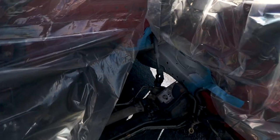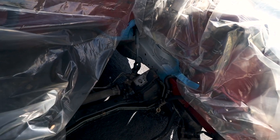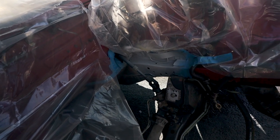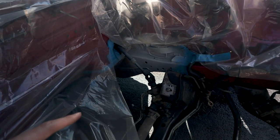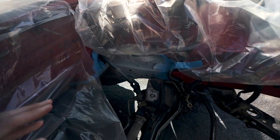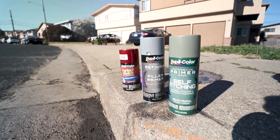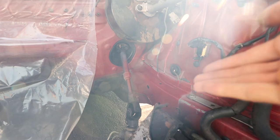Quick random update - I am painting the engine bay, a quarter of it, just so there's no rust. Definitely not the cleanest paint job. All that was bare metal due to me having a fat exhaust for a little while. All I did was scotch brite it, then etching primer, then regular primer. I'm gonna be on to the base coat so it matches. The color kind of matches - this is just a little faded. I'm gonna try to blend it in a little to make it more appealing.